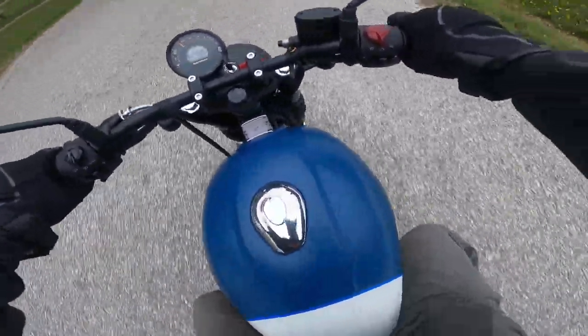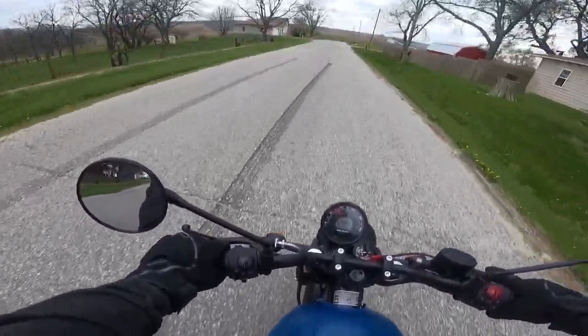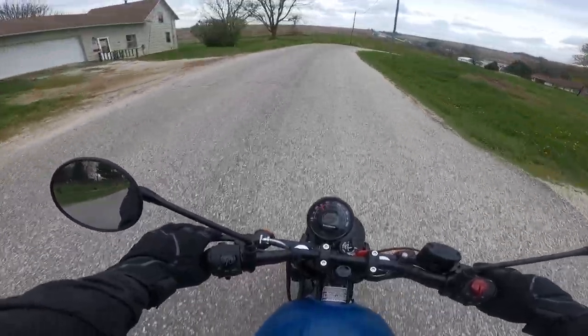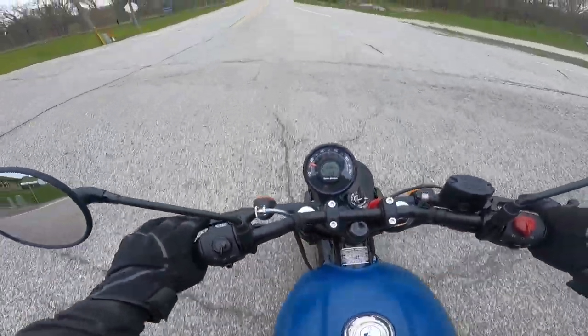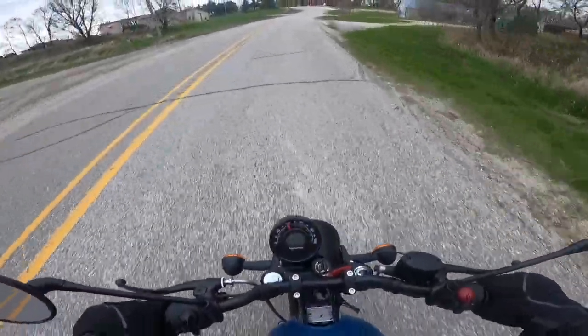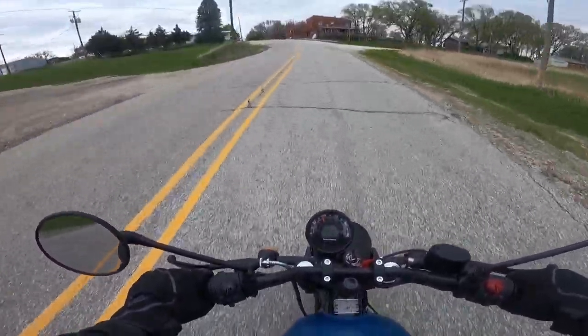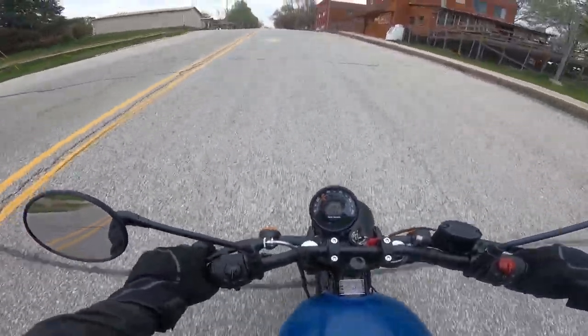I really like it. I think the back tire is a 140/70/17, and I think the front is a 110/70/17. The brakes are very good, with 10 miles on them. It's the lightest of all of them. It's got the 349 cc, 20 horsepower, 20 foot-pounds of torque. That's 27 newton meters of torque.